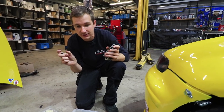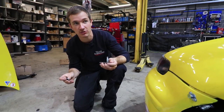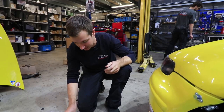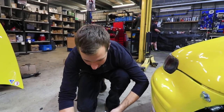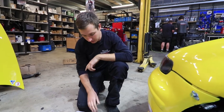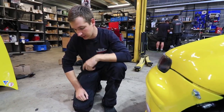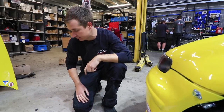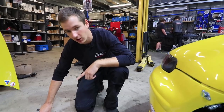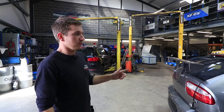You've got your fine adjustment on the toe to get it exactly where you want — say half a mill of toe out. If you're making a quick change at the track you can just whack one of these in and it's absolute simplicity at its best. It makes things a little bit more tricky when you're trying to even things out at the start of the job, but it's not impossible and it works really well. You've got all different sizes when you want to get finely adjusted if you've run out of thread adjustment. It says some stuff about the rear but that's for the Toledo touring cars which don't have the fully adjustable rear like we've got.